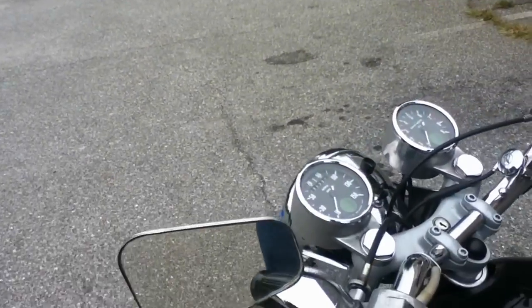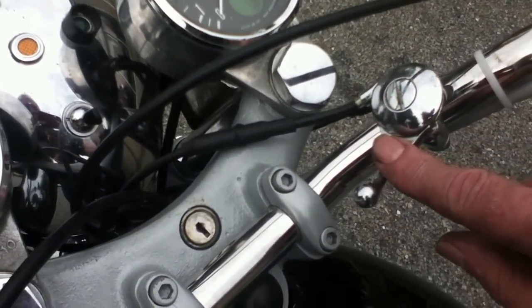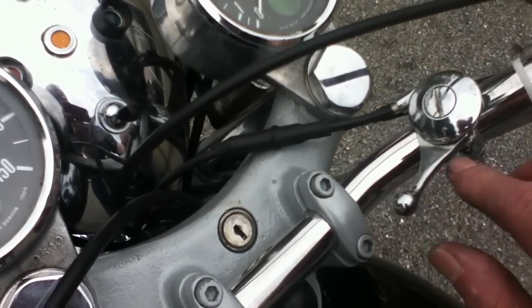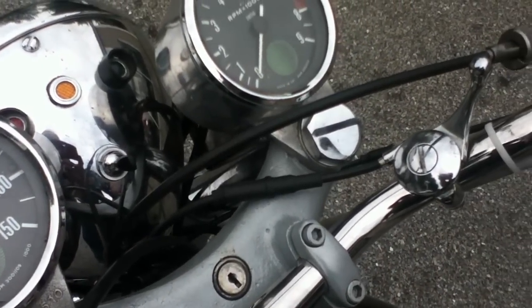Hi Trevor, I'm Jeff Connor and this is your new motorcycle. I'll go through and check the starting procedure with you, starting with the choke. I'll show that to you first — this is the choke lever right here. The choke is off right now; during cold weather you simply move it all the way to the right.